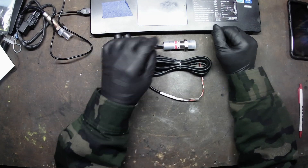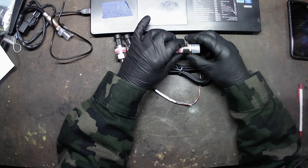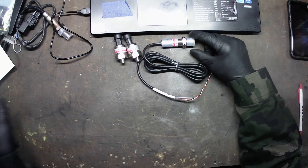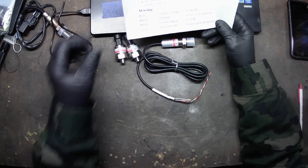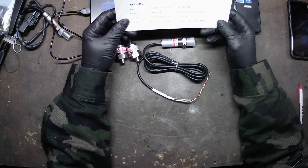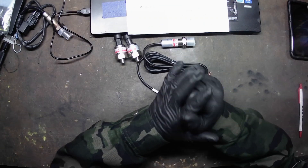Either way, it's going on the bike — I've got room for more sensors in the FuelTech, and I'm a glutton for punishment with technology, but I have to learn this thing if I want to get faster. The instructions are pretty straightforward. I've already added other sensors into this standalone, so scaling and setting them up is pretty easy. They want this sensor mounted at a 45-degree angle with the beam aimed at the center of the tire. Sounds easy enough.